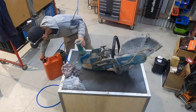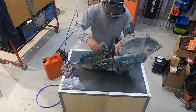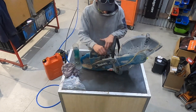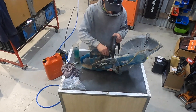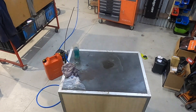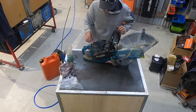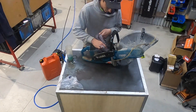This is a two-stroke so it's got a bit of oil in there, which will keep the bearings lubricated. I'll tip it in, spin it around and hopefully clean it out a bit, then tip it out and do that a couple of times. I flushed it out about four or five times with petrol and it looks clean as a whistle in there now. Not ideal, but that's the condition it came to me in, so nothing I can really do.